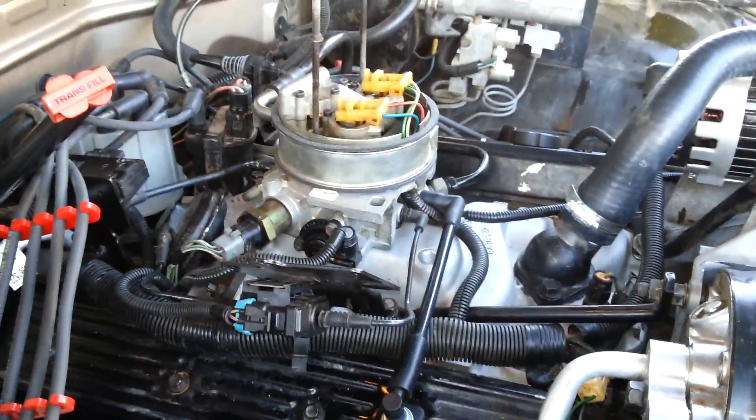To correctly set the timing on this motor, it's going to be set at zero degrees. Your pointer — it's going to be kind of hard to see down here. You're going to see your timing indicator; it looks like a fork, it's got teeth on it. The deepest groove is your zero setting. You'll find a line on your crankshaft — mark it with a silver marker or a white marker so you can see it. Your timing plate's deep groove is where the zero is.